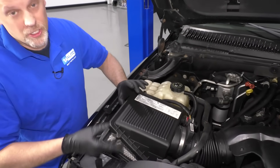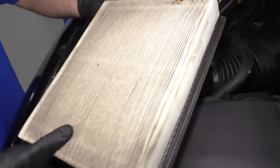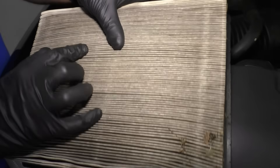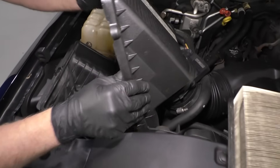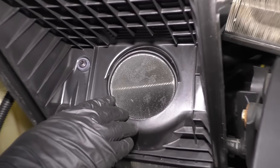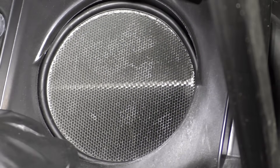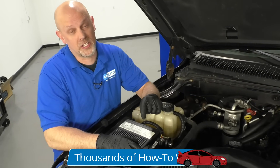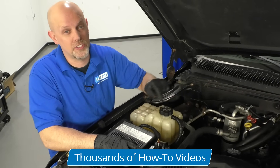Let's take a quick look at the air filter. Your air box may have clips or screws holding it down. Just take the air filter out and take a look at it — this one's pretty dirty. Now that's not going to cause the code, but if you had a hole in the filter where debris can get past, that's important and you should change it. While you have the air filter out, you can see the mass airflow sensor. I've seen in the past where a leaf can get by the air filter and sit in front of the mass airflow sensor — that can cause issues. It could get dirty and that could cause this code. It's not a very common problem, but the mass airflow sensor could potentially be dirty or sending a bad signal to the vehicle's computer, giving you that faulty code.